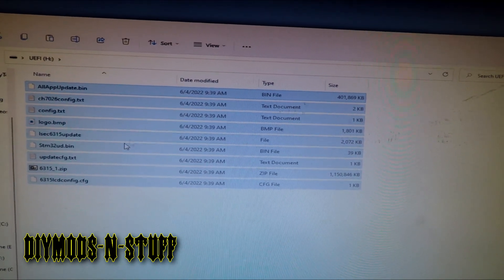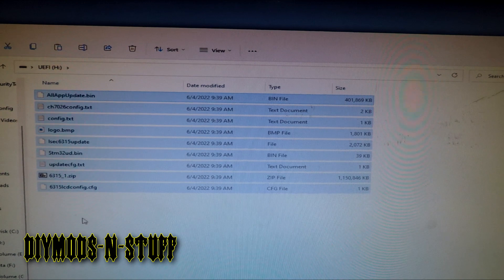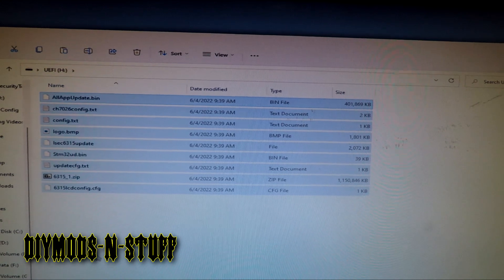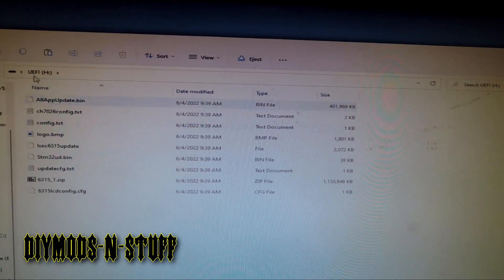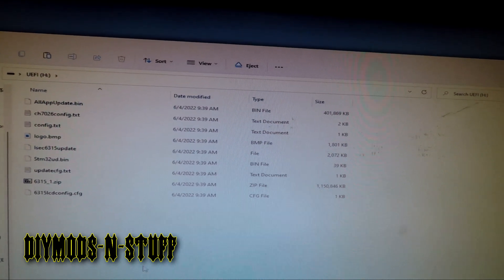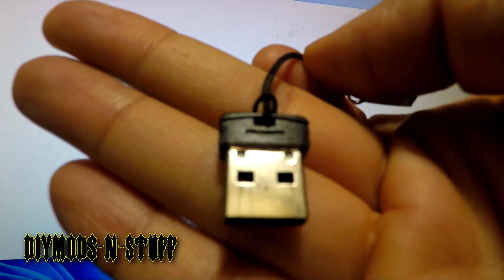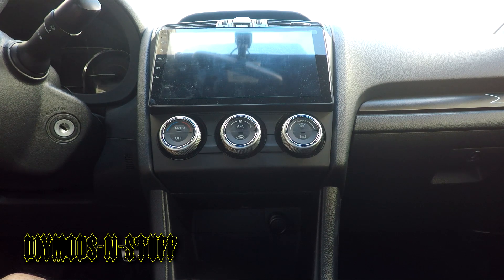The file copy to the USB drive has completed. One important note: make sure the thumb drive is formatted as FAT32. I have used NTFS and it worked, but I recommend FAT32. Remember, all files must be extracted to the root of the thumb drive, not inside a subfolder. Disconnect the thumb drive and then we're going to go into the vehicle and plug it in to begin the upgrade process.